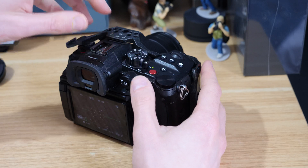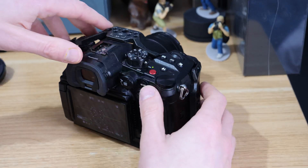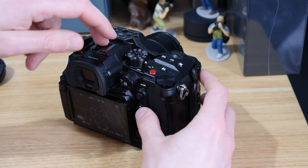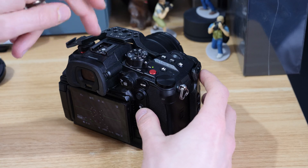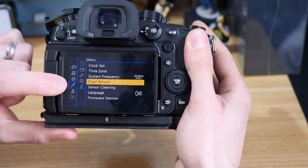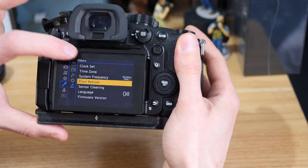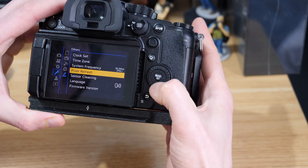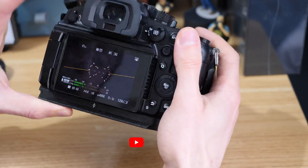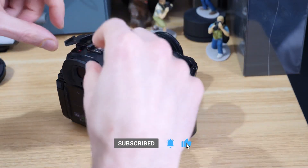They don't quite look the same. I did a video about cleaning the sensor so I'll link that up in the corner — it's always a good idea anyway to clean the sensor and keep the camera in good shape. But if you do have a hot pixel, you can jump into the camera, go into the spanner or wrench menu, and then again into the spanner — there is an 'others' menu and you've got an option called Pixel Refresh. You can go into that and just run it. I won't do it at the moment because I haven't got any stuck pixels thankfully, but what it's supposed to do is remap the pixel display.